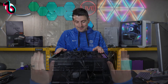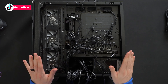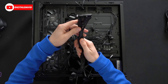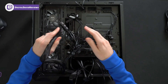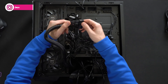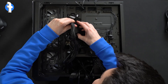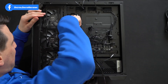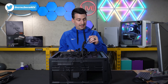Now it's time to plug in cables. We've got quite the rat's nest going on back here, but we'll get everything tidied up. First we'll start with the power supply — this is my first time building with back-connect and it's amazing. We take this cable, line it up, and it goes right in place on the back of the motherboard with a gentle snap. There's our main power.